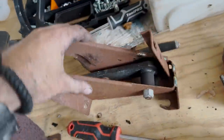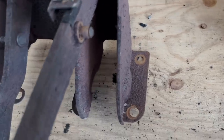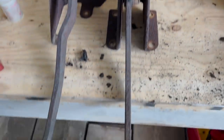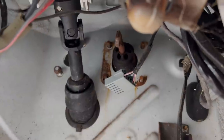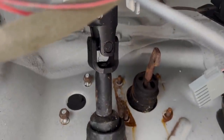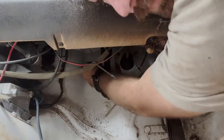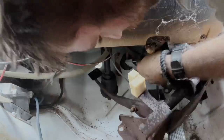So I've got the other one out — that's in there. It's just a single pedal for your brake for an auto. And then here's your clutch and then brake. I've taken the brake switch out of the other one, which is right there. So when the brake is disengaged, it will make sure the lights turn off. We'll try and manage to get that one in and bolt it up, but the steering column comes right through here, so I'm probably going to take the steering column out for it to work. You can see where it bolts up there, and that's the plate where the clutch master will come through.